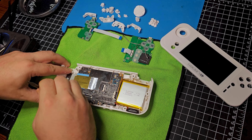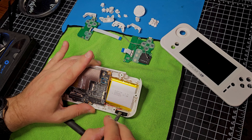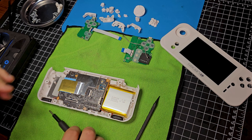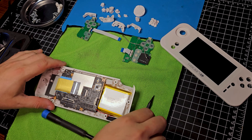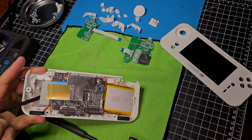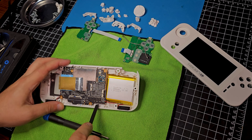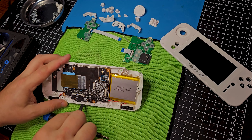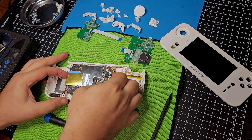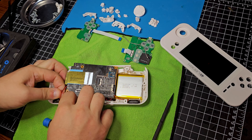Let me see if I can pry these speakers out - there is definitely some sticky residue on there, so it's probably double-sided tape. It's got some padding in there. Let's get the rest of this board out. Can this be lifted up? There's a thermal pad here to keep something cool - that's probably where the processor is. I'm not sure what this back plate is. Am I missing a screw, or is this clipped into place somehow? I think it's just clipped underneath so it doesn't move around even after the screws are taken out. The thing that's holding this in now is the speakers.